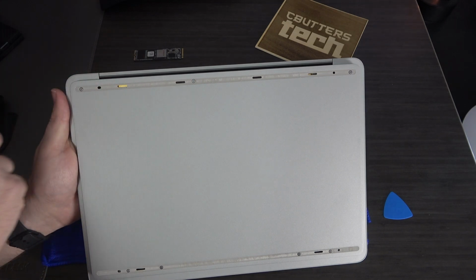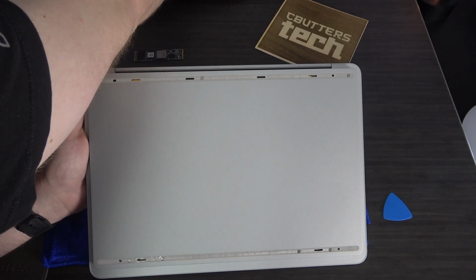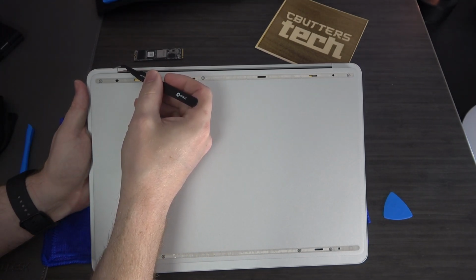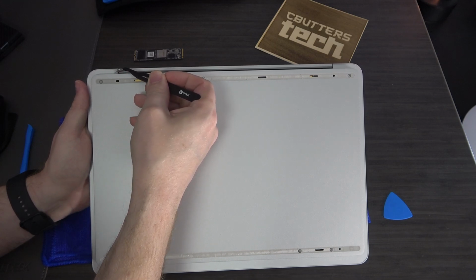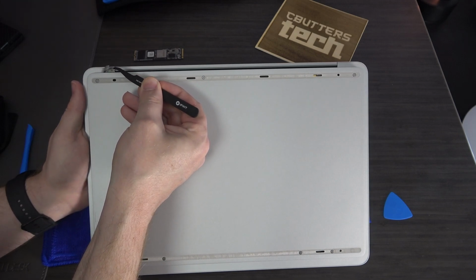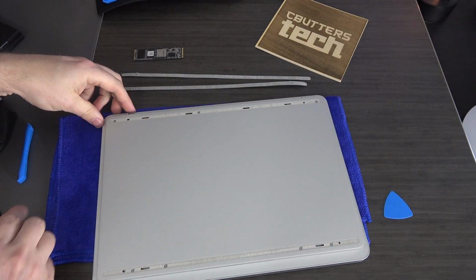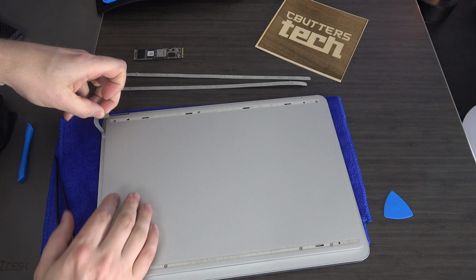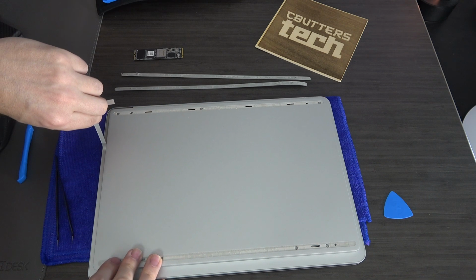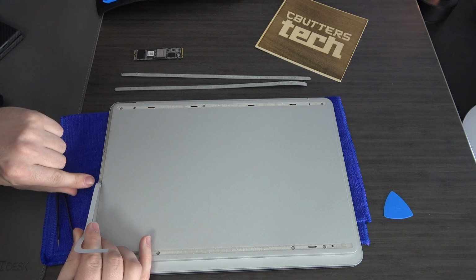And at this point back here, I'm actually going to use these tweezers here, and you can see if you just get right underneath it, it starts to lift. Hopefully that's showing up well. And once you get it started, again, super easy. And you want to be careful, you don't want to touch the backing very much, so hold it by the sides, and you only have to pull it until you expose the screw, which now we've done.